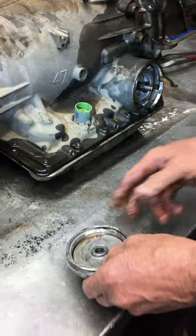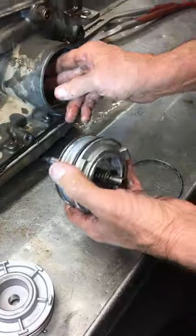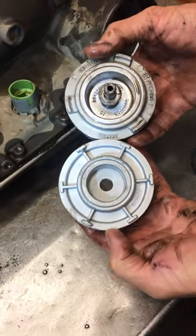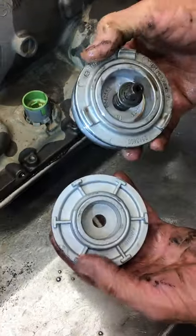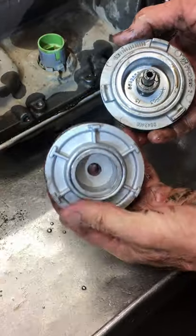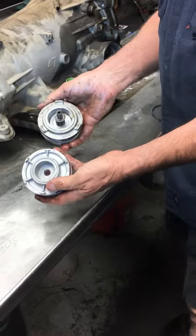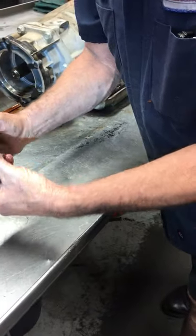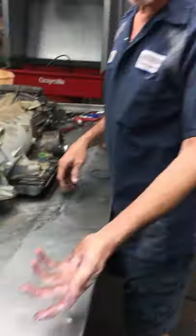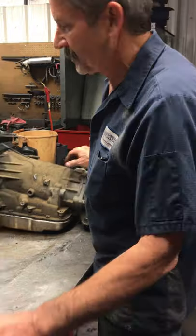Now you've heard of the Corvette servo. We have one right here. This is your standard servo for your pickup, Camaro, stuff like that. When you get into the Corvette, this is the servo. What they do is give you more surface area for the fluid to push this piston forward to apply the band, where here you can see there's just no surface area in the tube. When we do the Camaros and pickups and four-wheel drives, we'll usually change it over to the Corvette servo — just depending, because this does give it a bump on the shift and some customers don't like it. If you've got a high stall converter for a race car, this helps a lot and you don't feel the bump as much.